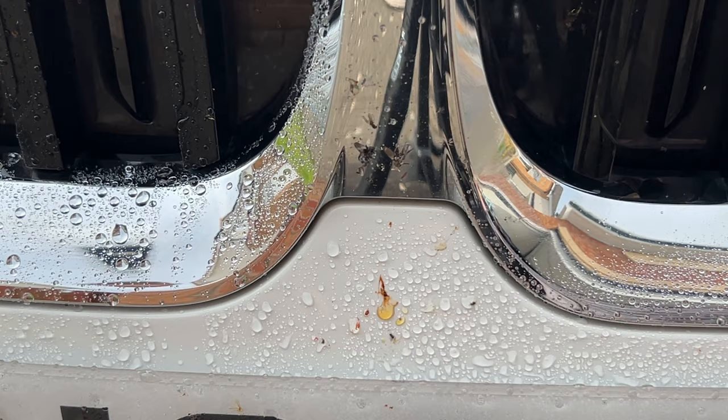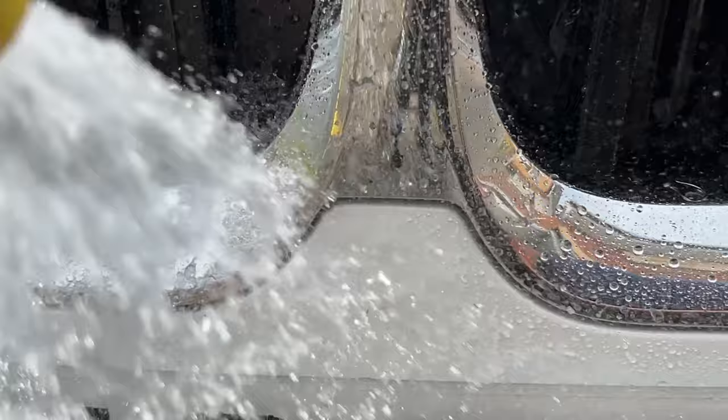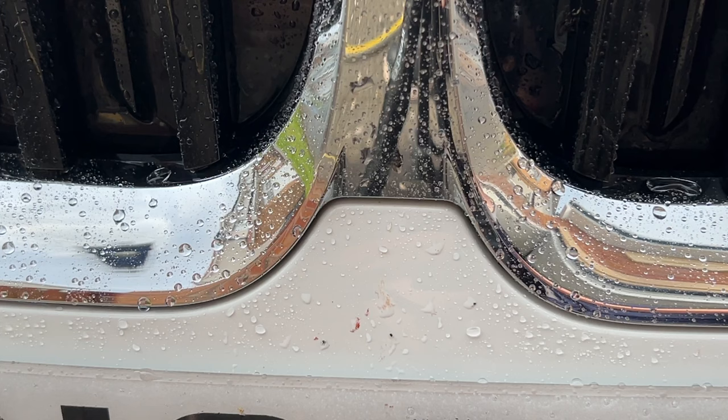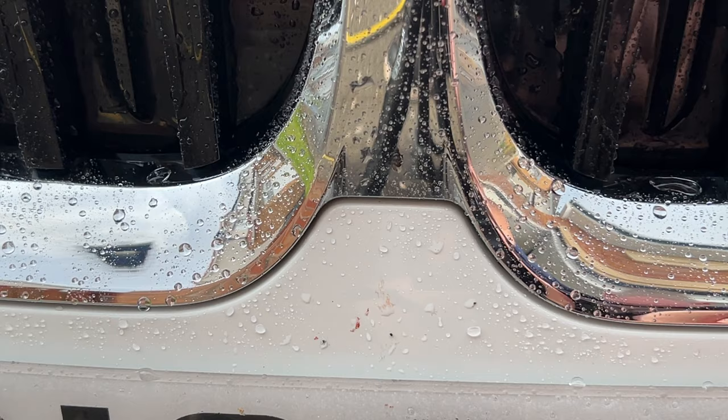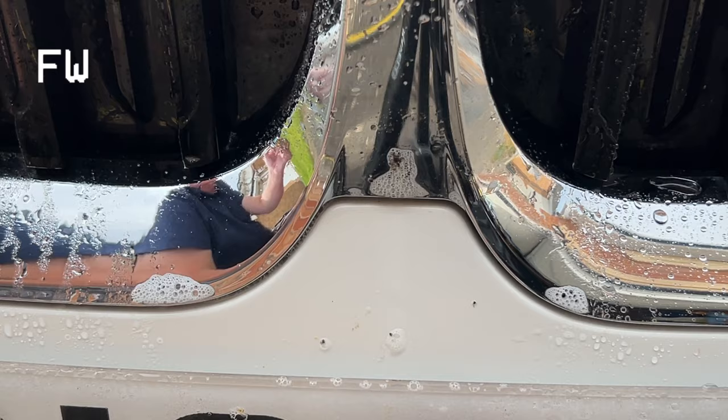For this last test I'm going to rinse any loose debris away, then come straight back in with Garage Therapy Zero Decon Shampoo again — remember it's the 10 to 1 dilution — just to see if the dramatic wax-removing effect it had earlier shows up on this section too. This little area has a fly body on the chrome and smaller traces of blood below. I'm not going to agitate this section; seeing as there's a little water already on the panel, maybe it'll dilute it enough to remove the bugs but also be kinder to the wax underneath.